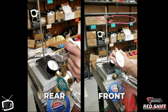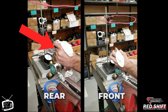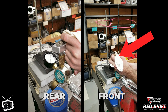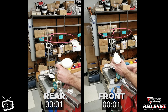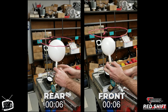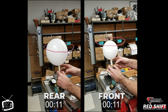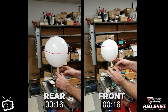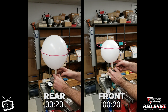We are checking a rear piston cooling jet and its operation at 30 psi. This is the front piston cooling jet, which has a restricted flow, also set at 30 psi. We are using an 11-inch ring for comparative purposes to know when we've reached the same diameter.